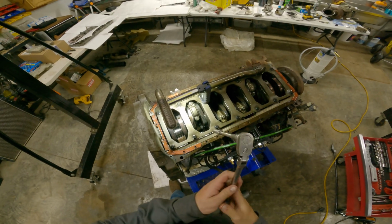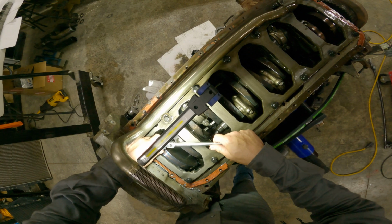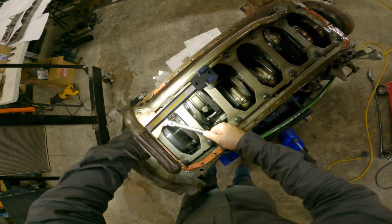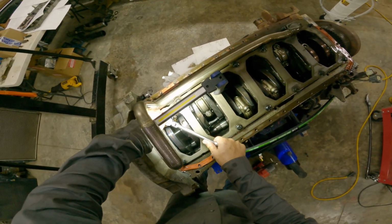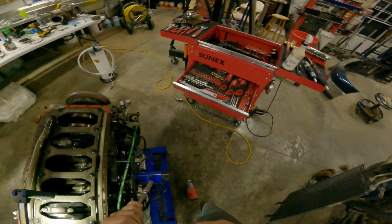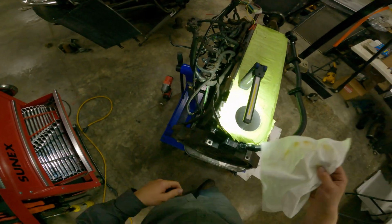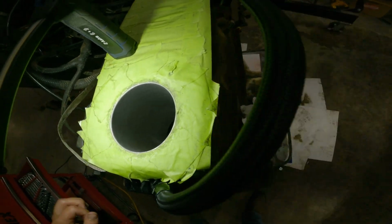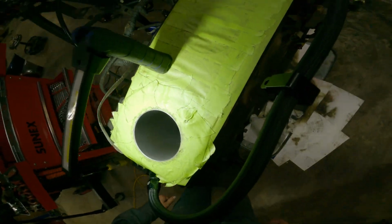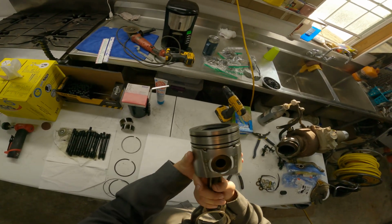Perfect. Like everything on a Cummins, you torque them down to 18 foot-pounds. That's, you know, what everything torques down to on a Cummins. Ah, 18 foot-pounds. Oh yeah, crosshatch is shining now. Alright, I think it's got her really, really good. That was a lot of hand scrubbing, but we got all the carbon off where it mattered.